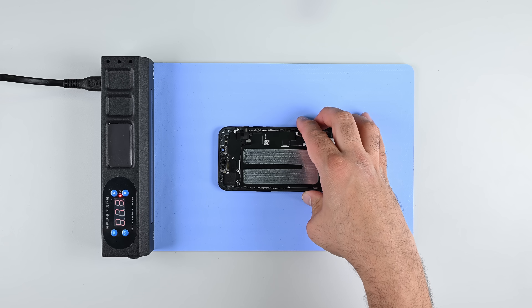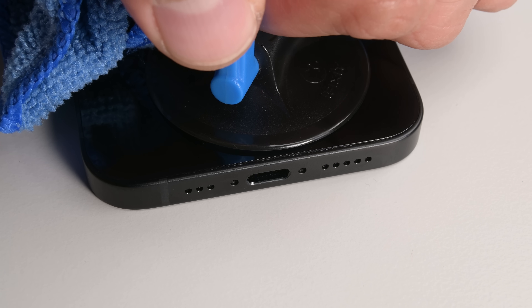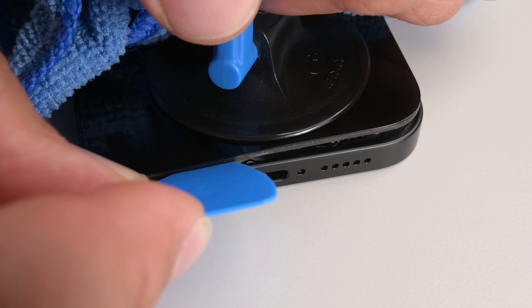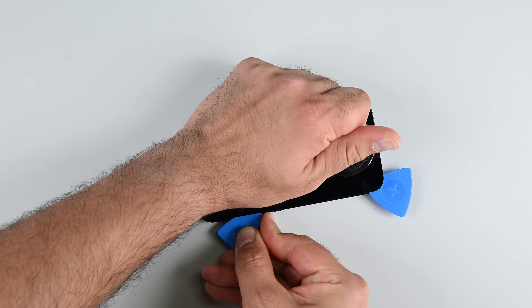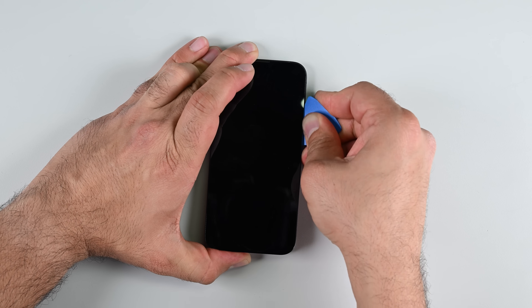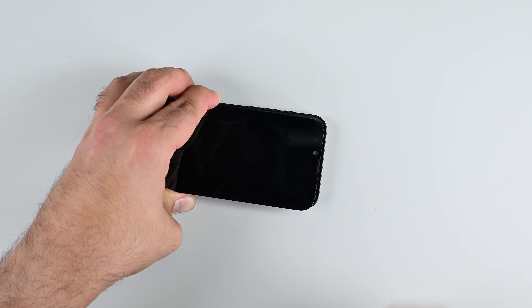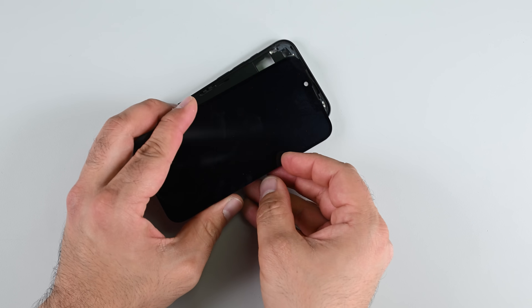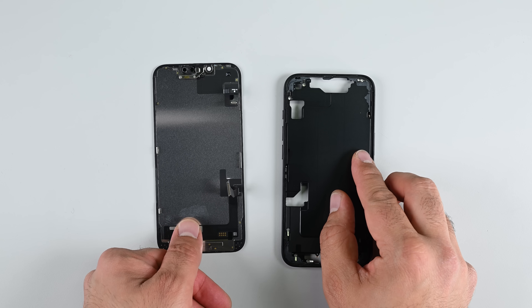The screen, as with most modern iPhones, is a pretty easy component to remove, but it does need a fair amount of heat. Never exceed 110 degrees C if you're doing this yourself, but you can leave it for 20 or 30 minutes on a heat pad if needed, to help liquefy that glue and make your life easier. After that, it's just a matter of slicing through the adhesive with an opening pick. Do be warned, the two flex cables from the screen are not protected by the metal brackets like the back cover is. Be careful not to slice through them.